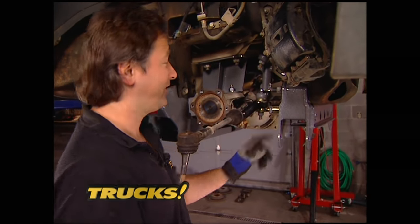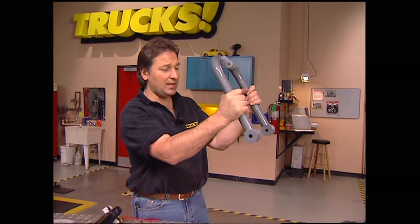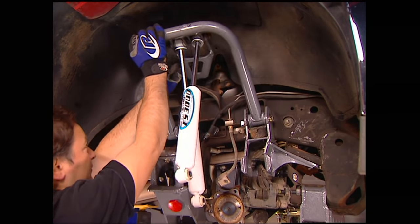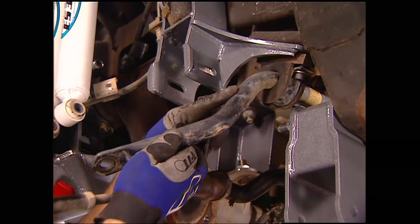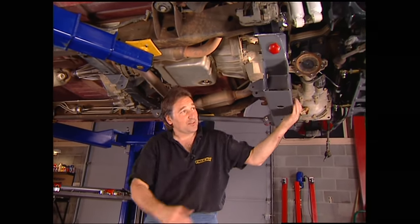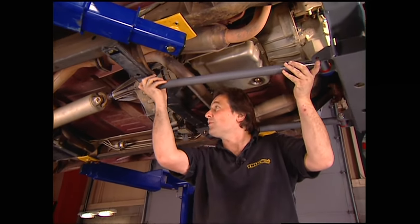It's also very important that there's no binding in here. Now it's time to get out from under the front and move to the side. Our kit comes with the dual shock option, so we're just going to slide these hoops into place in the old upper A-arm pockets. With the hoop in place, we'll bolt on the bracket which relocates the upper A-arm. Then the shocks and support bracket all rotate up and are bolted where the old shock used to go. The factory sway bar is remounted upside down using these spacers and the supplied hardware.